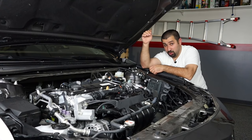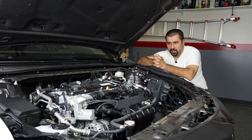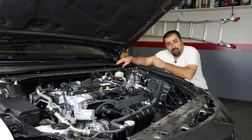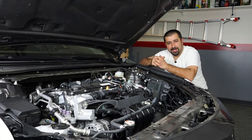This high-pressure fuel pump is computer-controlled and can control the pressure — it pressurizes fuel to 3,000 psi, so it's really high pressure, and servicing the system needs special care. It has a metal pipe that goes from the fuel pump all the way to the injectors, which I'll show you in the aerial view. The other component the system has is a vacuum pump. In direct injection cars there's not enough vacuum creation in the intake to support the brake booster for power brakes, so they have a small vacuum pump that runs off the camshaft and goes directly to the brake booster.